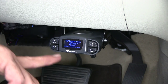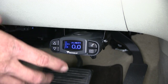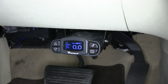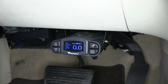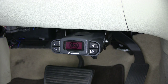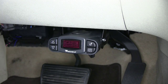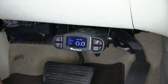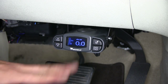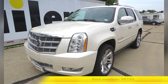Now we can see that we've got power coming to our trailer — everything's fine there. Now that we know it's recognizing the trailer, let's unhook it and make sure it flashes and gives us a signal. It has constant monitoring so if something happens with our connection it's going to let us know. The screen should turn red and flash 'no trailer connected' to give us an indication — just like that. With everything working as it should, that's going to complete today's installation of the Tekonsha Prodigy P3 proportional trailer brake controller, part number 90195, on our 2009 Cadillac Escalade.